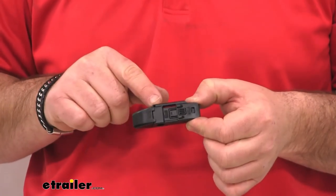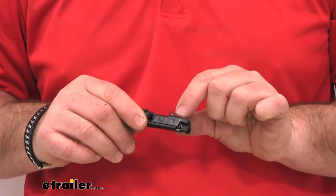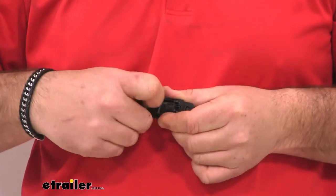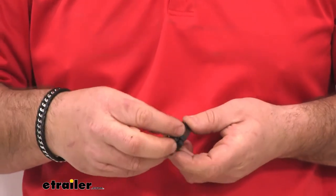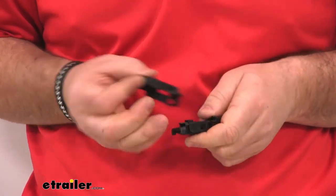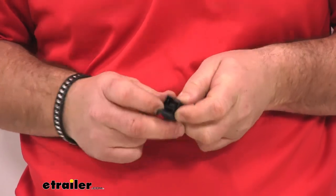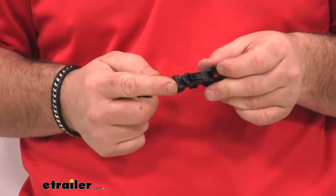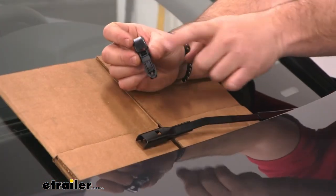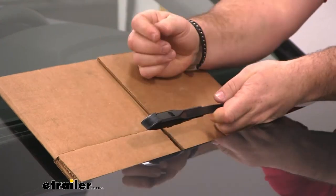You're going to have a piece that comes in your kit with your new windshield wiper blades. You'll notice there are little arrows on the sides — we need to remove a couple of pieces on this. There are a couple of arrows on the side; we're going to pull back just a little and kind of go up with it. Then we're going to have another piece — pull out on the two sides and take that piece off. Then this back piece here, we're just going to pull it out. It's going to be easier if you take this piece and put it on your arm first before you put it on your wiper blade. Just slide it in and let it lock into place.